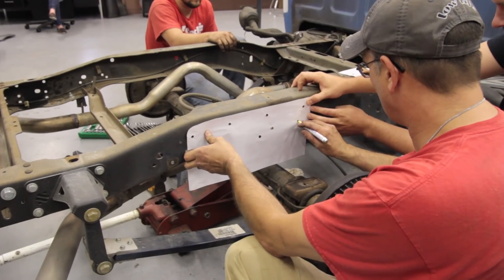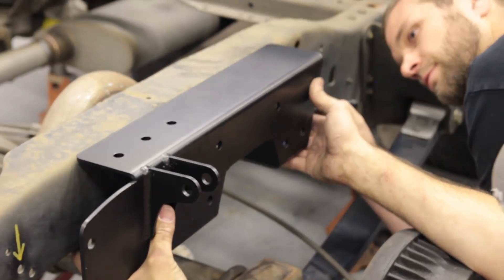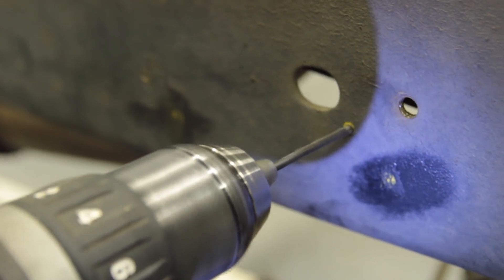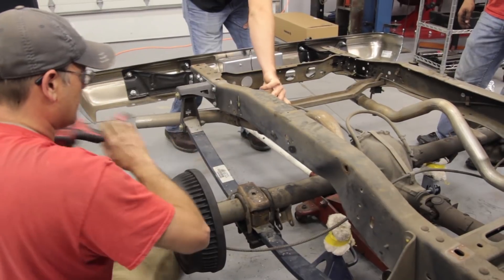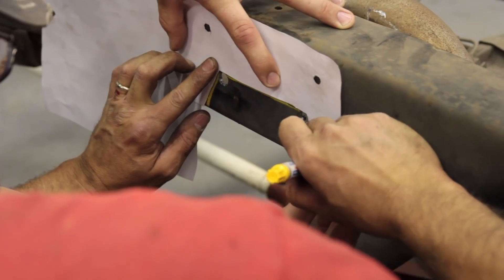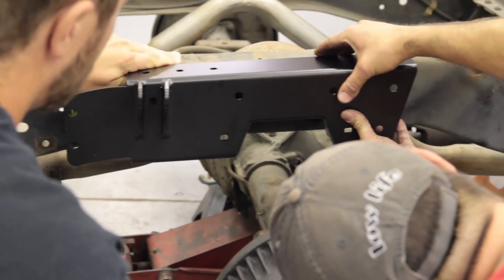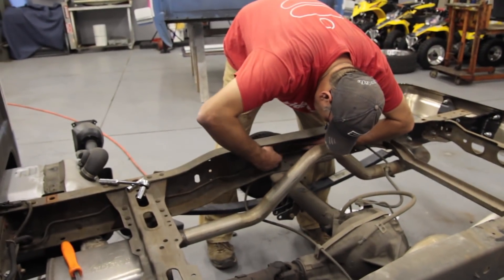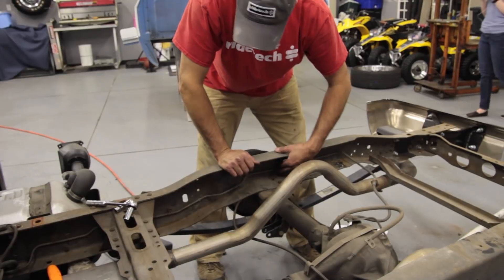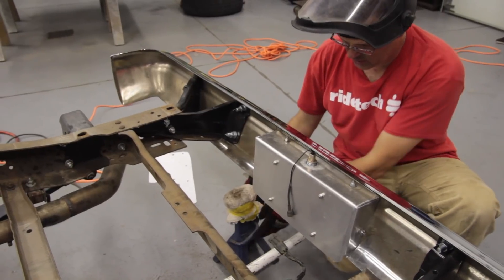I like to start with a pilot hole for the half-inch holes in the corners of the C-notch — that way you don't strain yourself or your drill. Once those holes are drilled, I mark where I need to cut. I'll hold the C-notch up one more time before cutting to double-check. I'm also removing this brake line mounting tab because we need to cut through this area to mount the C-notch. Before cutting, I'm going to support this rear frame as a precaution.